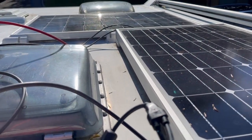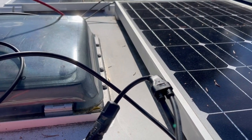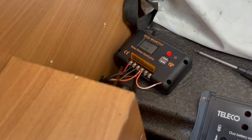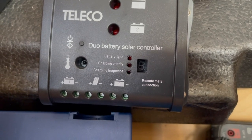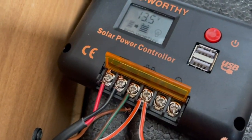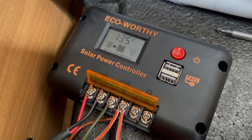That's it - if you've got space on your roof and want to add a panel, it's probably not a massive job, two hours at most. Most of the time is just prep - making sure the roof's clean. I've still got to put some screws into that panel, just a couple to hold it. So we'll move on to the solar controller next, which is going to be upgraded. I've taken out that old Teleco one - it's a good few years old. This replacement is 20 amps, so it should be sufficient. It's charging slightly now as you can see. There's a manual button to put the load on - it's one I've got from a folding solar panel. I'll eventually probably upgrade it to a better one and monitor how it works.